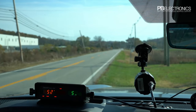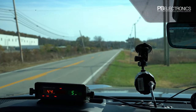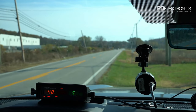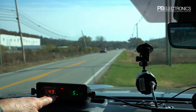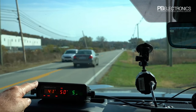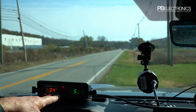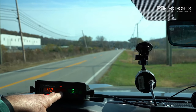This is a very sensitive radar — in the open prairie in Texas, officers have reportedly locked in a speed and waited for the driver to get close enough to write a ticket, sometimes five miles away. The fast window shows a car going faster than the strong car only if they're faster than the strongest or front car; if the front car is already the fastest, you won't see anything in the fast window.